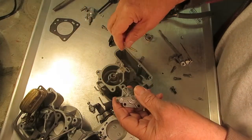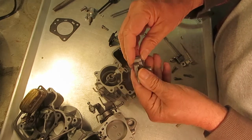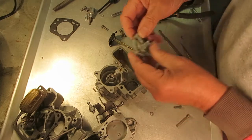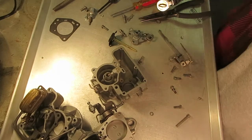The pressure pushes the check ball down so that the gas doesn't flow back into your float bowl. That's how this one works. Be sure these are all clean, and like I said, don't take this apart unless you've got a really good reason to, because you may not get it all back together. That's it on this type of YF — thank you for watching.